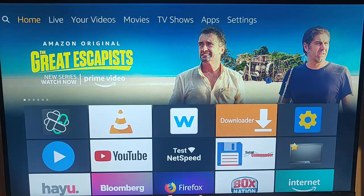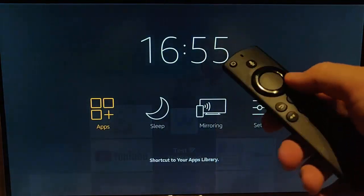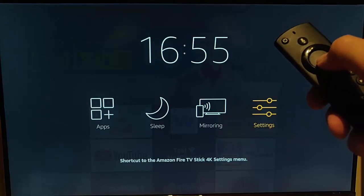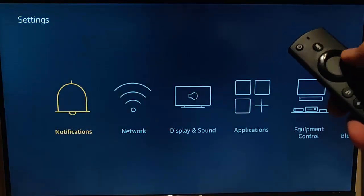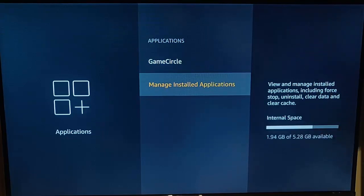If you've still got problems with the app, check that you've got enough space on your Fire TV stick's storage. Grab your remote control, press and hold the house button until the menu appears, then go across to Settings, press the middle button, and go down and across to Applications, then down to Manage Installed Applications. On mine I've got about 1.94 gigabytes available. As long as you've got over 1 GB, you should have enough space for most things. If you've fallen below one gigabyte into the megabyte section, you should really consider cleaning out some of your apps.